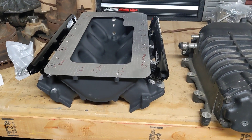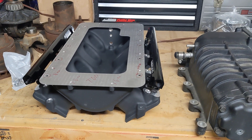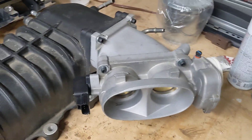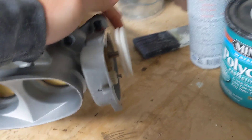It will work with either the short or tall injectors. I'm going to be running the LSA or LS9 injectors, which are the short ones, and I'll have plenty of room. It appears the tall injectors — like the standard style ones — would work also. I'll be running a GT500 throttle body with the factory TPS.